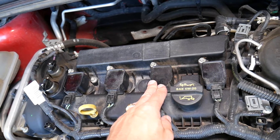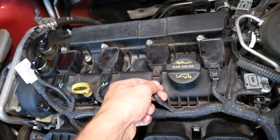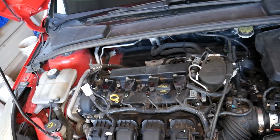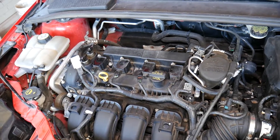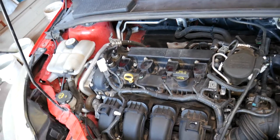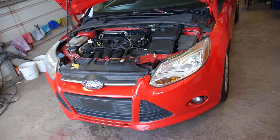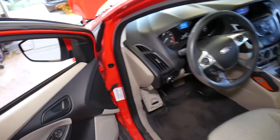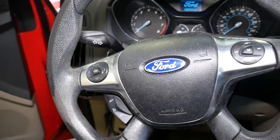The last digit of the code corresponds to the cylinder number, so it indicates we have a problem with ignition coil on cylinder number three. All we have to do is disconnect it, check your wiring harness to make sure it's not loose — sometimes that can trigger the light as well. We just need to remove the bolt with an 8mm socket and replace the coil. We have a complete video on the channel explaining how to replace coils and spark plugs, spark plug gap, and all that. We'll have the link for new coils in the description.